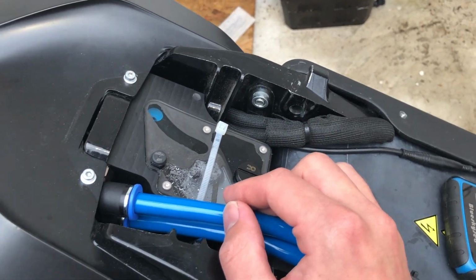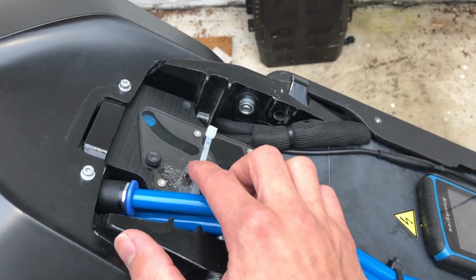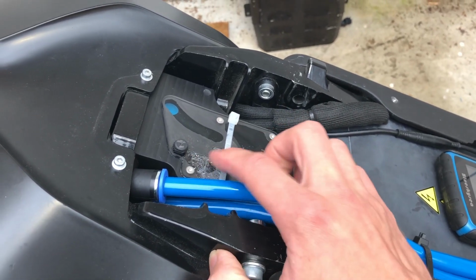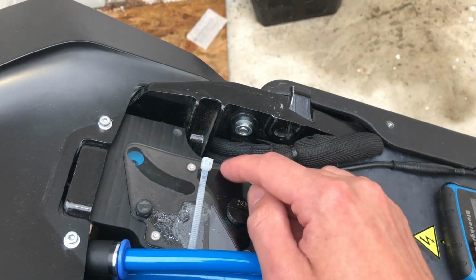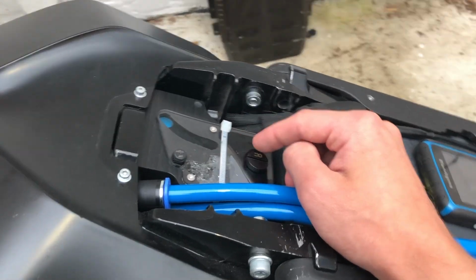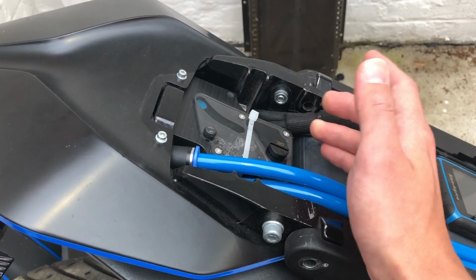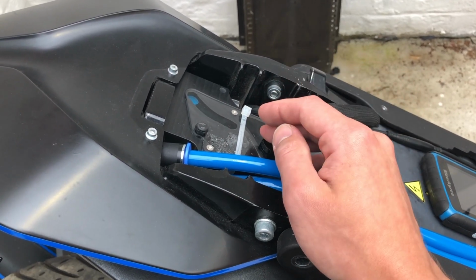And the other thing we can see is this little piece here. This is a breather, so a pressure equalizing element. And first off, I didn't think I would need it, but still it gets pretty hot sometimes. The expansion of the cooling fluid and also the air pocket inside here is substantial, so it actually started leaking around here. I pressed the fluid out of the reservoir, and every time it did get cold, it pulled in more air, and my Zero did lose some cooling fluid, and it all went down the drain. Since this is not good in any way, I had to add this element, and now it will equalize the pressure inside the system, and hence I don't have any more fluid leaks on the system.